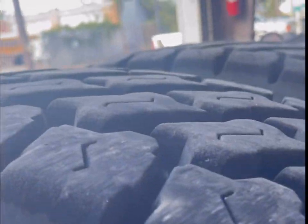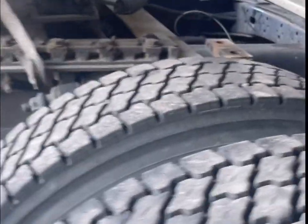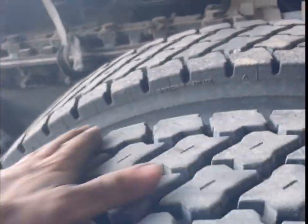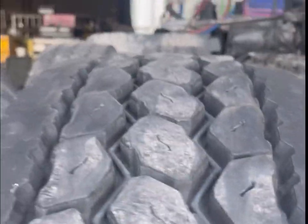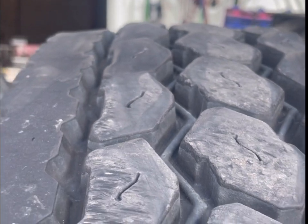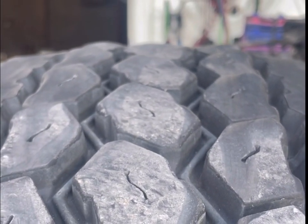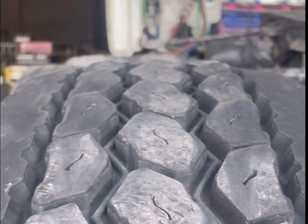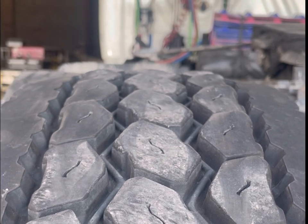Another way to tell is when you look at your tires — you'll see cupping inward on one driver and cupping outward on the other. When you look at tire wear like this, the center is barely worn down but the outside treads are worn. Anybody guess what that's caused from? Possibly tire pressure. We're gonna do some educational stuff here.